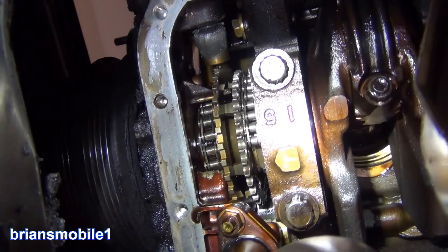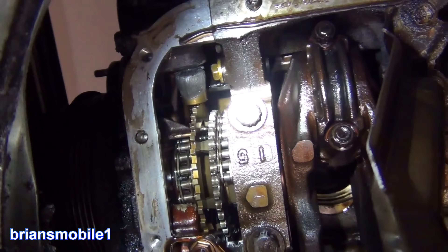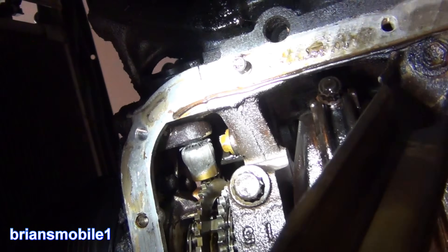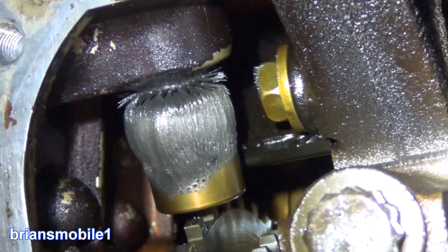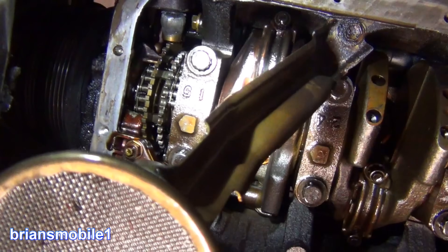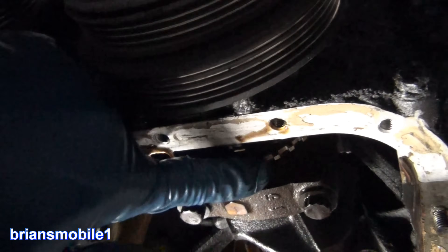As I look in here, that's a chain that just quits — it's not on there and it just stops. One chain's on and one chain's off. So we've got some timing issues. Speaking of timing, look at the crankshaft position sensor — it should have been a code because that thing is so covered in metal. It's a magnet but just not where it counts. So we lost a timing chain. One other minor discovery — not a big deal — our exciter ring, tone ring, whatever for timing, is shot.